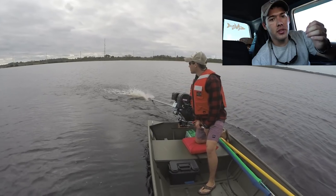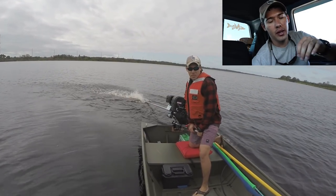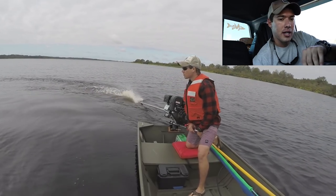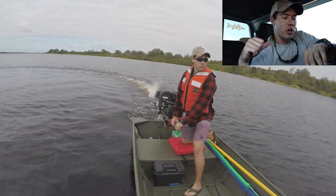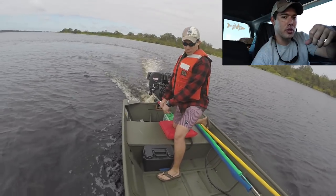In short, there's not enough tail weight. The prop wants to rise up out of the water and shoot out of the wake, and that's a big drawback. I didn't want to pull up on the handle because in the past they've had issues with their transom bracket — they used to have small little blue ones that would pop off the transom and hop into the boat with the operator.